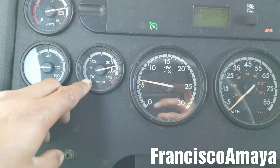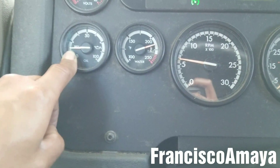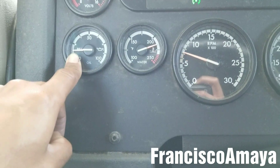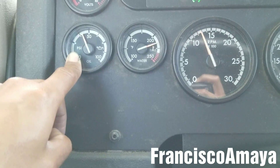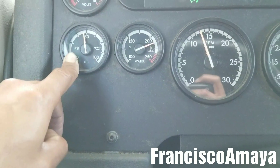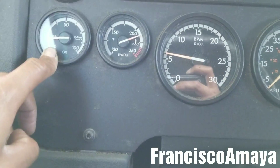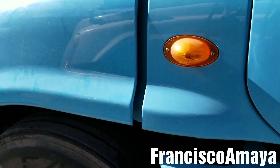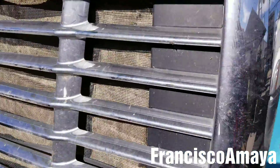With the engine running at maximum temperature, the oil pressure is stable — that's a good oil pressure reading. The fan just kicked on, which means the temperature has reached its maximum, and the oil pressure is still at a good level. If I floor the engine to around 1300 RPM, the oil pressure should go up to around 50 PSI — and it does. Walking around the engine, there are no weird noises at all. The engine is running with zero problems.